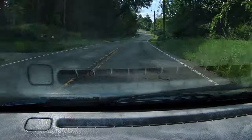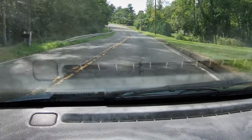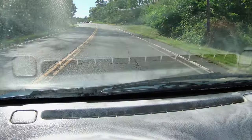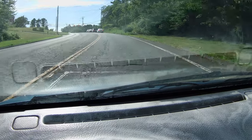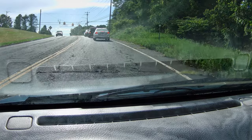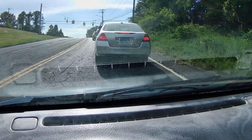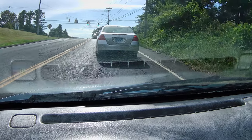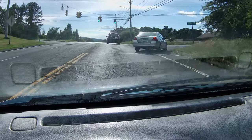And I'll tell you what, dude, this little engine woke up. Now it actually has power to go up the hills with AC on. It just picks up and goes now. The whole time I'm thinking, man, this little three cylinder must be really worn with 224,000 miles. This thing is struggling up the hills with AC on. Nah, turns out it was just the timing. The ignition timing was set to 0 degrees. This thing was gutless.